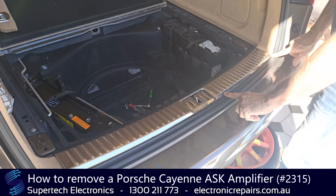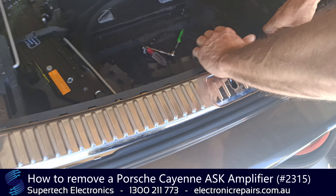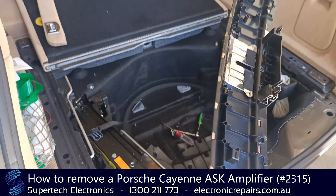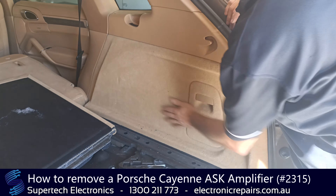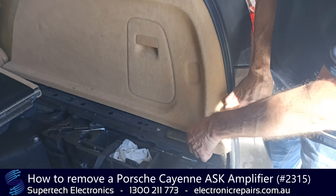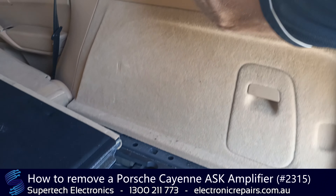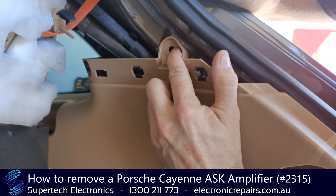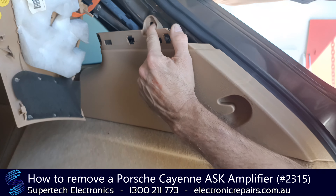This one's held in with clips under this rubber lip, so it's just a case of pulling it. This bit just gets removed with clips and we can put that all aside. Now this next section is held under this rubber wedge — under this top part here. There is a plastic wedge that holds it in there; you'll need something to pop that out. Some of them are threaded and you'll need to screw it out.